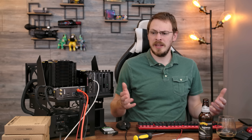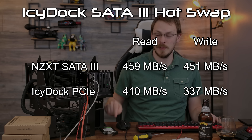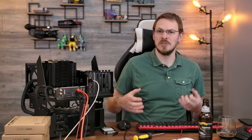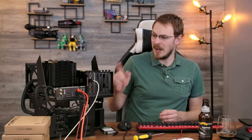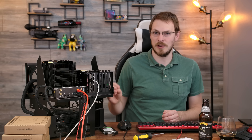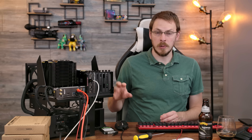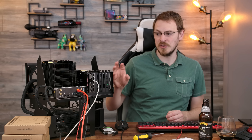The very rough numbers are in, and over the SATA interface we saw a 14% faster write speed and a 34% faster read speed out of the SATA-connected drive over the hot swap drive. That's a fairly large disparity when you're talking about high-speed storage. The reason we're seeing this disparity is because of Icy Dock's decision to use a PCI Express 2.0 bus, limited to 4 gigabit per second. The drives and the controllers inside the hot swap are both SATA 3 capable at 6 gigabit per second, but the PCI Express bus is actually slowing us down.